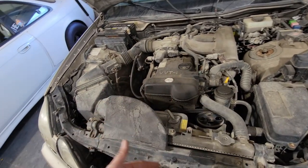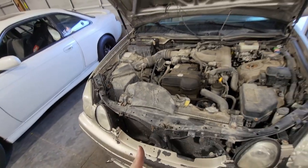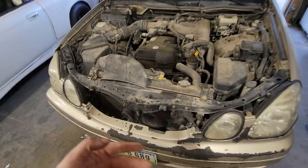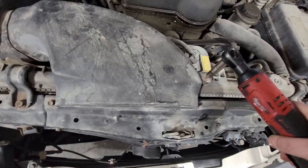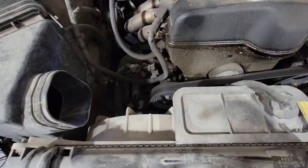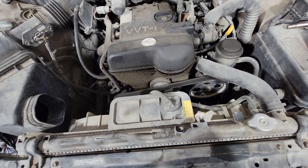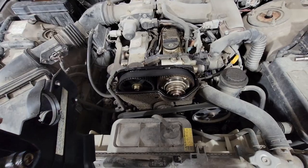It's about as easy as it can get. I just drove this so I'm probably going to take apart a couple components and then after a little while take it the rest of the way apart, because I will have to drain the coolant and since I just drove it, it is hot. This will pop off and then you can access the front half of the engine. The next thing you want to do is remove the radiator, as you're kind of in a spot where you can't reach anything.